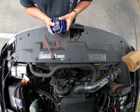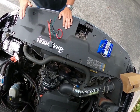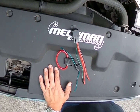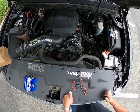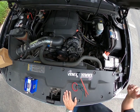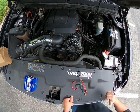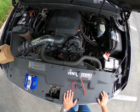If relays intimidate you, if this wiring intimidates you, don't order it. In most cases you can get away with just your cookie-cutter 14.8-volt charging. You can't charge AGM batteries higher than 15 volts — well, you can for a little bit but then it blows up. So 14.9 to 15 volts on regular AGM batteries is fine. If you try to run 15.5 to 16 volts on these, you're just going to swell them up and they're going to pop, and then you're going to blame the alternator.